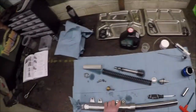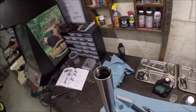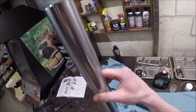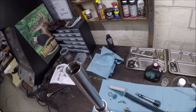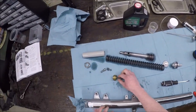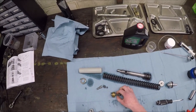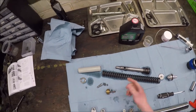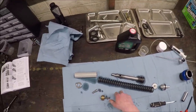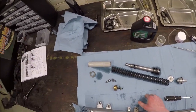I had started to make a how-to video because the first fork went so well, but then I realized when I reassembled it the first time I reassembled it incorrectly. So I probably shouldn't be doing a how-to video on forks right now. I did get my little Harley emulator out and I just set it to three turns of preload - it had no preload on it when I put it in before, which I was worried about.